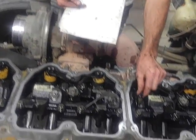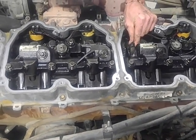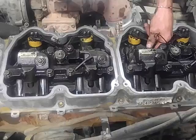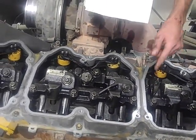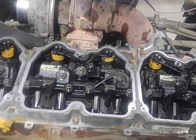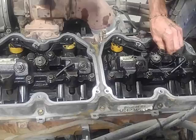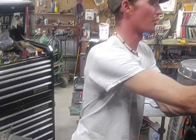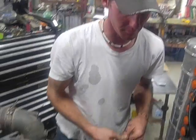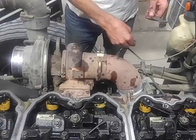if you look at your rockers, you can see how this valve is pretty much at the top, and the exhaust valve on 5 is pressed down. Look at my sheet, 5 intake, so we're on number 6. So you can grab them, check them. Now obviously we're doing an overhead because mine are tight. Like number 5 for instance, there is hardly any slop in there.